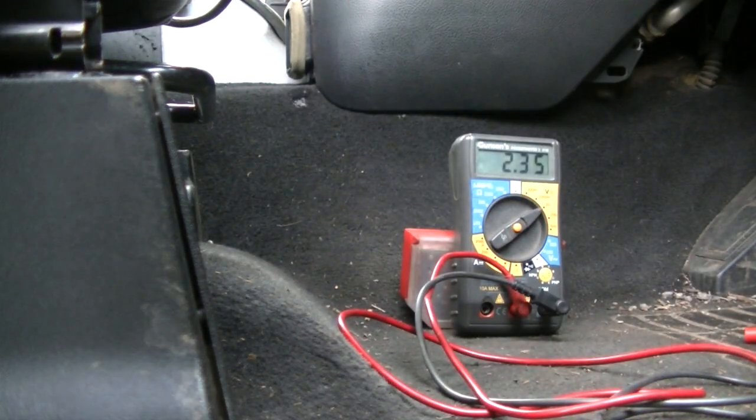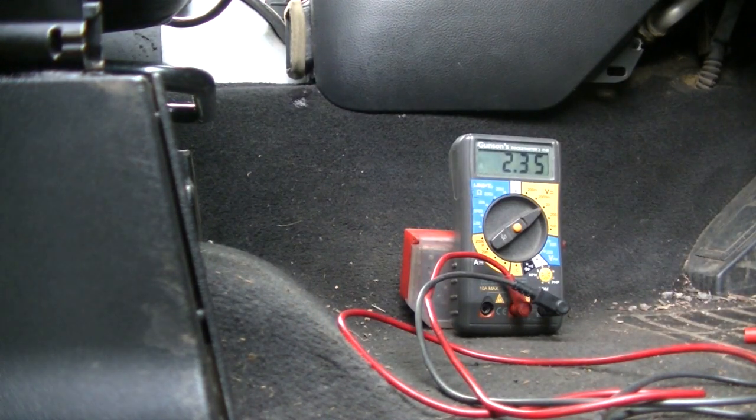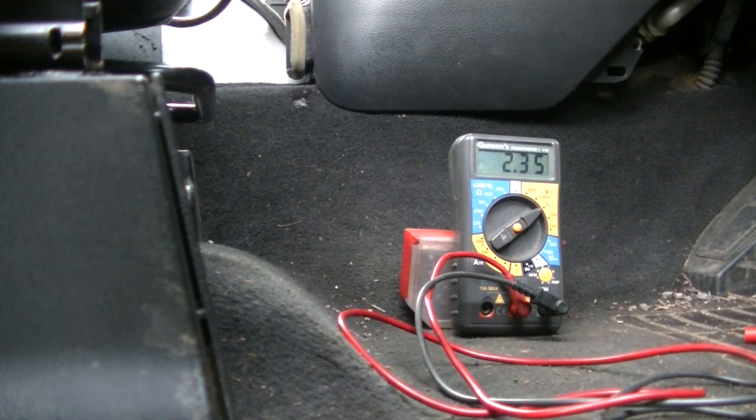So, could it be a short in the wiring to the electronic parking brake module, which is why it happens on two modules? But again, why would that affect the yaw sensor readings, which is on a completely separate network and is connected directly from the yaw sensor to the ABS module? Never the twain shall meet. But everything else checks out fine, apart from when you disconnect the electronic parking brake module. The CAN voltages change.